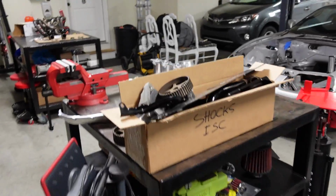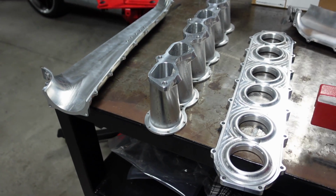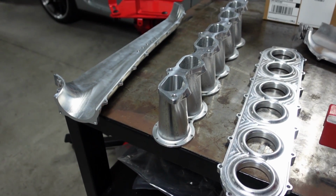With this, I don't see this breaking, and I know some people, again, griped about O-rings, but if you look at any other big boy manifolds, they all use O-rings. Ryan Samet's big boy Hypertune, running all the boost in the world, is an O-ringed manifold, to give you perspective. There's no welds on it.